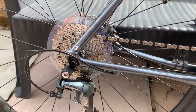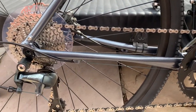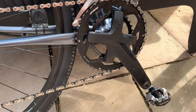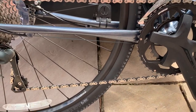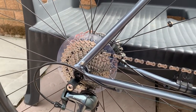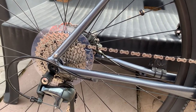I just wanted to make a correction — talking about gear ratios earlier, this is an 11-34 with a 46/30 on the front. So that gear ratio is 30 teeth divided by 34, which is 0.88 — not 0.95 as I said before. So 0.88 is the correct gear ratio. I just wanted to correct that.